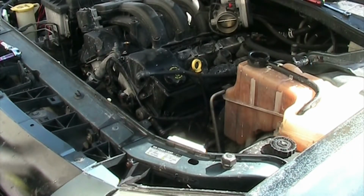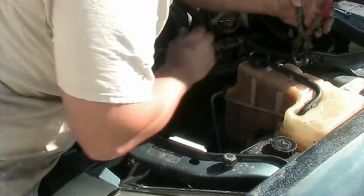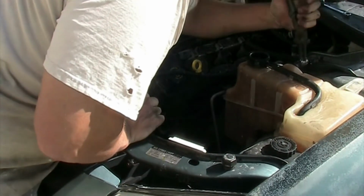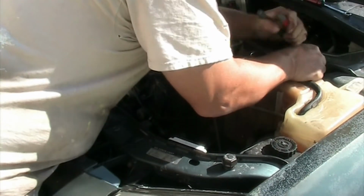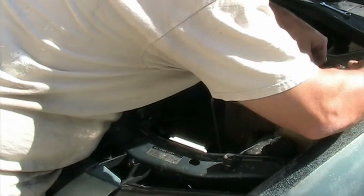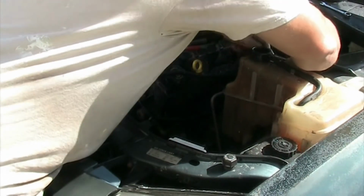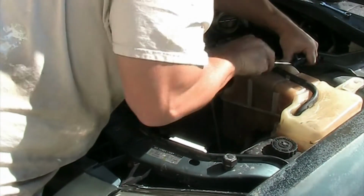So just find the right pliers. I couldn't find them right away, but as you can see here, I've already done the first part in the rear for the air bleeder, which was in the first video of this series of 2. And so I just use the correct pliers, which are pliers I use for welding, which allowed me to get a big enough grip to move that clamp backwards. Make sure that when you put these clamps back that they are sitting in the same spot.